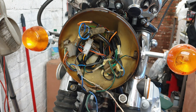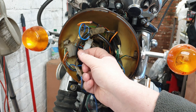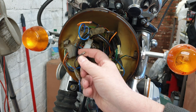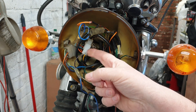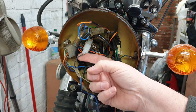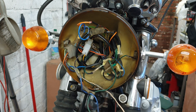Another part that's again for an American version of the bike is the indicators having a buzzer. This wire — brown with light blue — is for the buzzer, so it would go to the buzzer and then the buzzer would be there. This does have power coming to it when the switches are switched, so I do need to make sure I cover it so that it's well insulated, otherwise I could end up with a fire in this rat's nest.